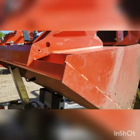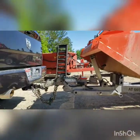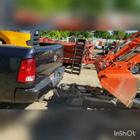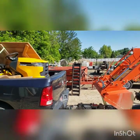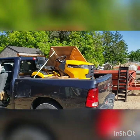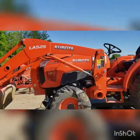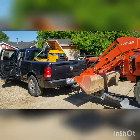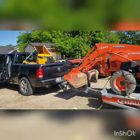On the trailer, there's some pretty tight clearance on the bucket right here, but I've got that bucket resting in there. The concern might be a sharp turn, so you definitely want to watch out for that if you've got a bucket on the front. I've got the Cub Cadet and a picnic table loaded up in the back as well, so definitely pushing a lot of weight for the truck. It's got a compressor and airbag system on it — I pumped that up to 45 psi and that seemed to level it out pretty nicely.